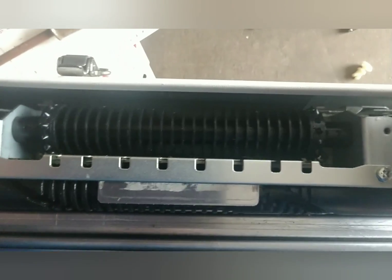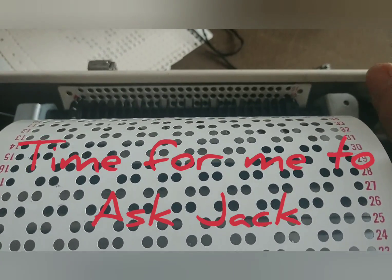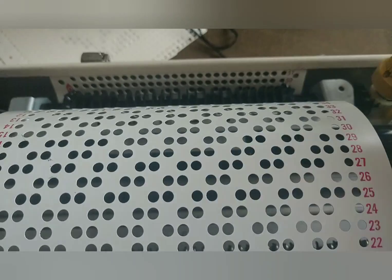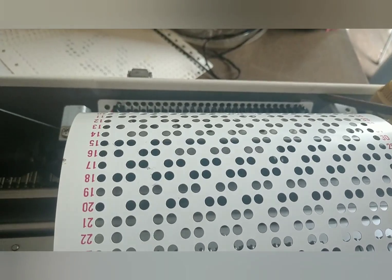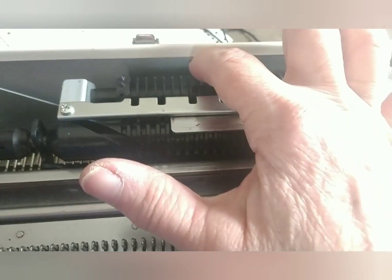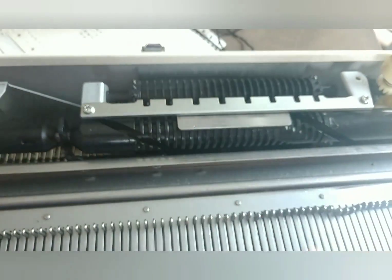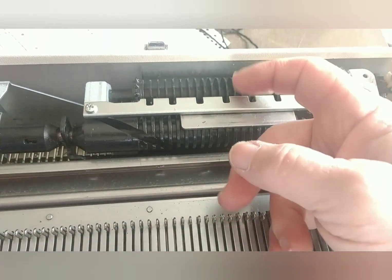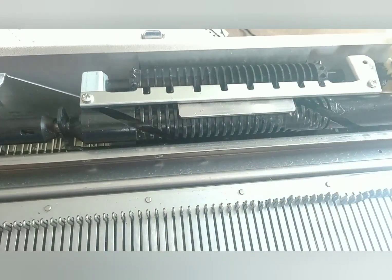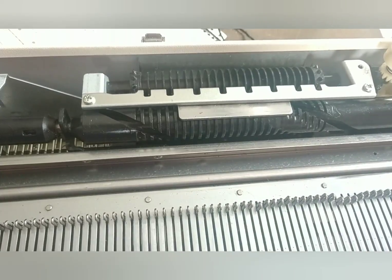Now I'm in here looking for an impediment. I found it, and it's weird. The card is catching on the lip of the actual case. I'm going to flex the lip of the case, and you see there's a backslide for the card. The steel piece — it's not part of the case. There's the case, and there's a separate piece of metal. That should be towards us, shielding the card from bumping into the case. Not sure how it got disarranged, possibly in a move. But we need to bring it forward and make sure it stays there doing its shielding job.